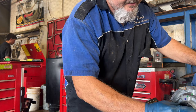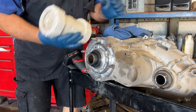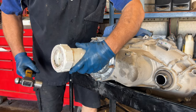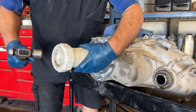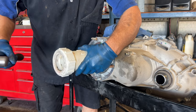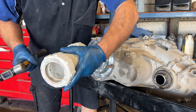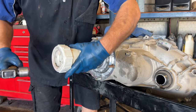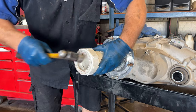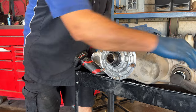I slide the front seal up on there and start it with this three-inch sewer pipe — an excellent seal driver. It's very rare to encounter a seal this won't fit. I like to stand back a bit to keep an eye on it, and gently tap around to get it straight. Centering is actually super critical. I'll put a block of wood on here if needed, then give it a solid strike and knock it in. There it is — installed. Nothing to it.